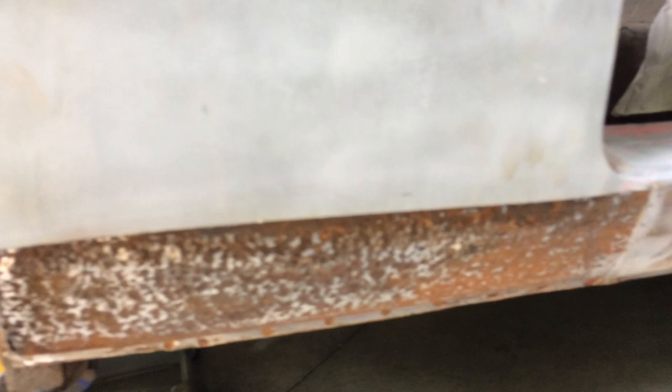That's just a basic everyday garden variety repair. I'll make that patch soon, but first I want to get this guard wheel arch done, and then I'll make the patch. But that's all got to be sandblasted — I'm not putting it back over like that. That's beyond rust repair — that's got to be sandblasted. There's a hole here, and it's all got to have that rust converter blasted up inside there and primed and painted. It's hard to see that, but it's done.